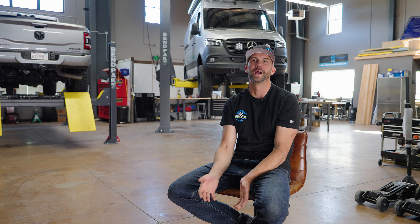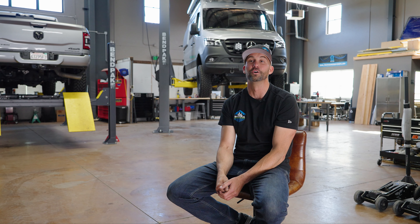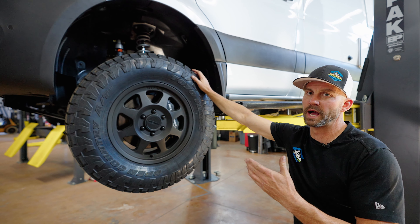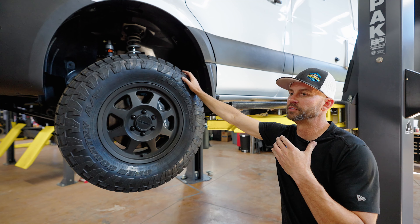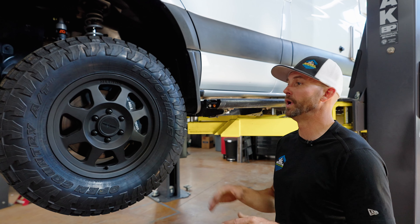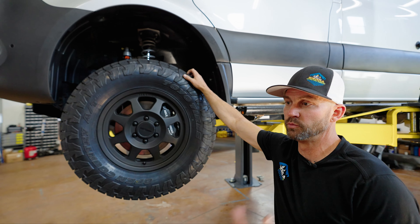The relationship started with Agile when we ordered our first RIB kit. That first pallet showed up with the leaf springs on it and the shocks in a box and the coilover kit, and we knew we had a good product even before we drove the van. Any Sprinter van, and certainly the Winnebago Rebel, leaves the dealer lot with inadequate suspension. The symptom you'll feel is this swaying, this sort of boat feeling you get when you hit a bump, when you hit wind, when you go off-road for sure. The way we like to address that is with a RIB kit.